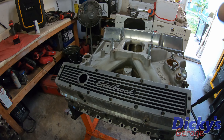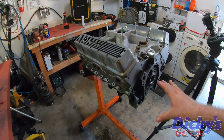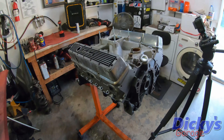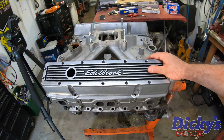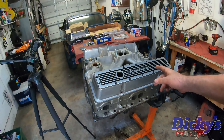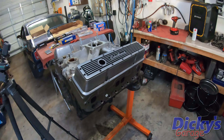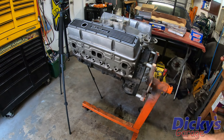I'm really liking what I'm seeing here — this thing is starting to come together. That little vision I've got in my head is really starting to materialize. We've got that classic muscle feel and I think I've got the potential to make enough power to get those radial TAs off the ground. But I still have that nervous feeling — I've got to figure out how to make this thing run at 14 to 1 compression, and that's not going to be easy. My plan is to run E85. That's why we're calling it project ethyl — ethanol fuel. So this is a corn-fed dinosaur: old school hard iron parts with the modern day fuel.